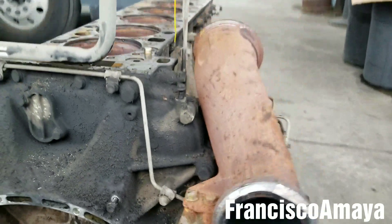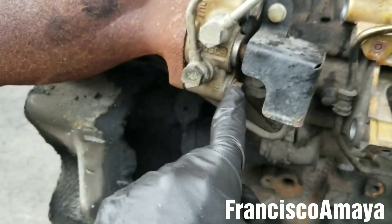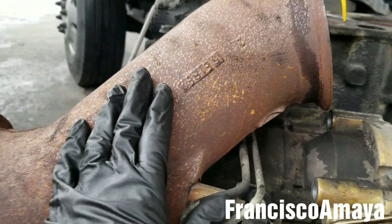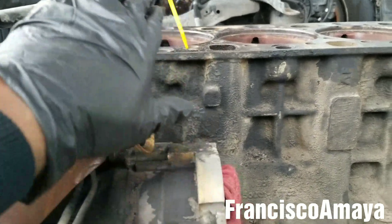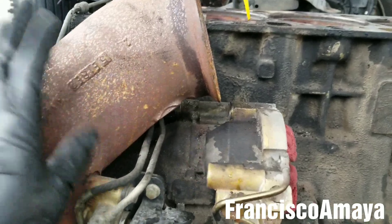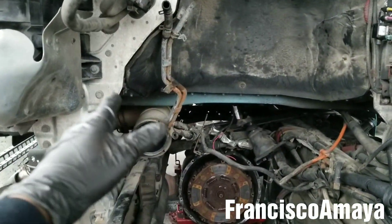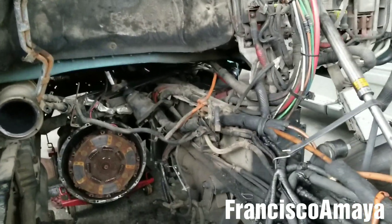The first step will be to remove these two doser injector cooler housing ports. You have to remove those bolts. We're also going to take out this clamp — the one that goes to the turbo compound or power turbine. For 2014 and older engines, you have to remove this pipe; for 2015 and newer, they don't have this anymore — it's a straight pipe to the turbo. Take these out and leave the housing hanging while you make some room.